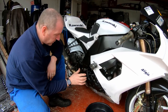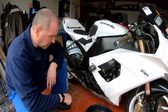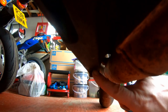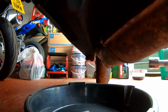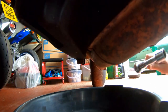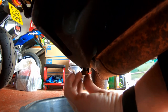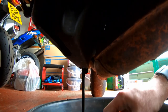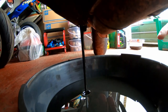We've got the belly pan off. What I'm going to do first is drop the oil. We're going to be putting fresh oil in as part of this process and I'm also going to fit a brand new oil filter. First thing I need to do is get underneath and crack off the sump plug. Underneath the bike here's the sump plug — that's pretty tight — and once she's out just allow the oil to drain into the drain pan. Let's give that ten minutes to drain out and then we can look at getting the clutch cover off.